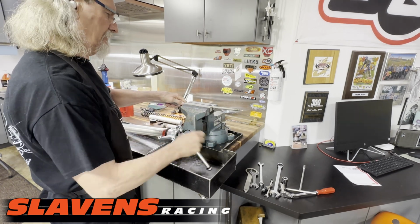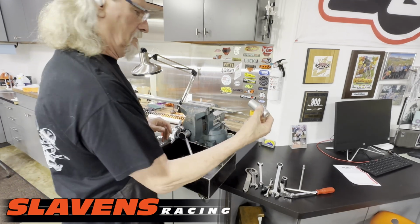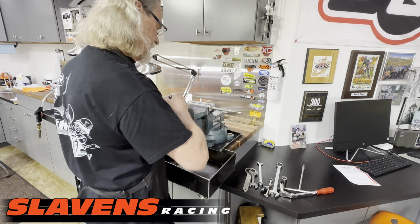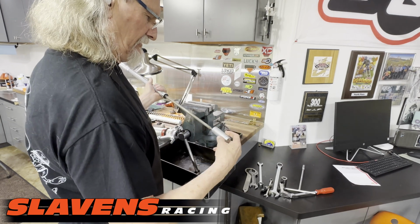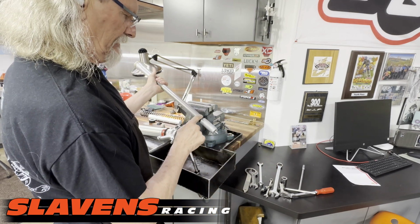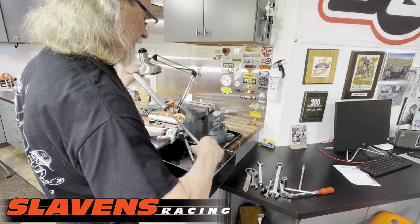Okay, now we'll reverse what we did before. This piece needs to go on. This is the anti-bottoming cup. This is mounted onto the shaft. Then the fork bottoms. This piece here goes into here. This is full of oil, so it creates a hydraulic block. Right now, it hits metal on metal, but when it's full of oil, it won't do that.